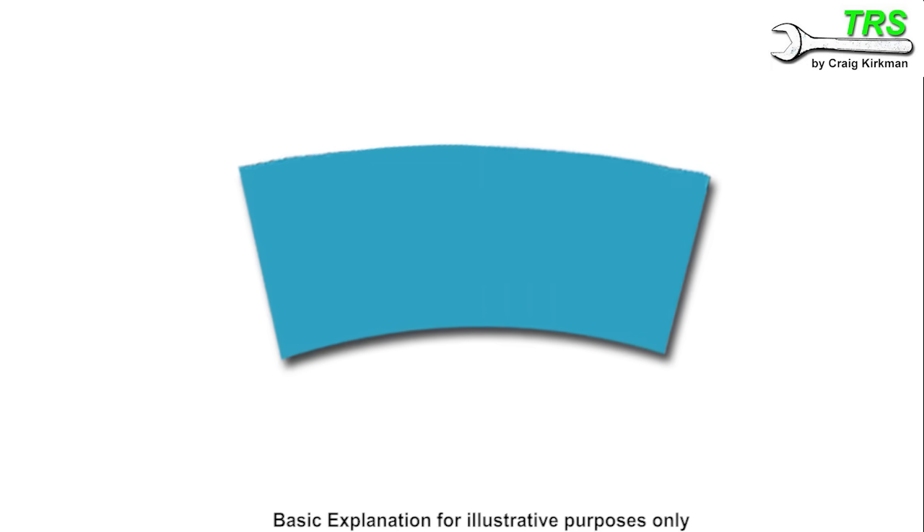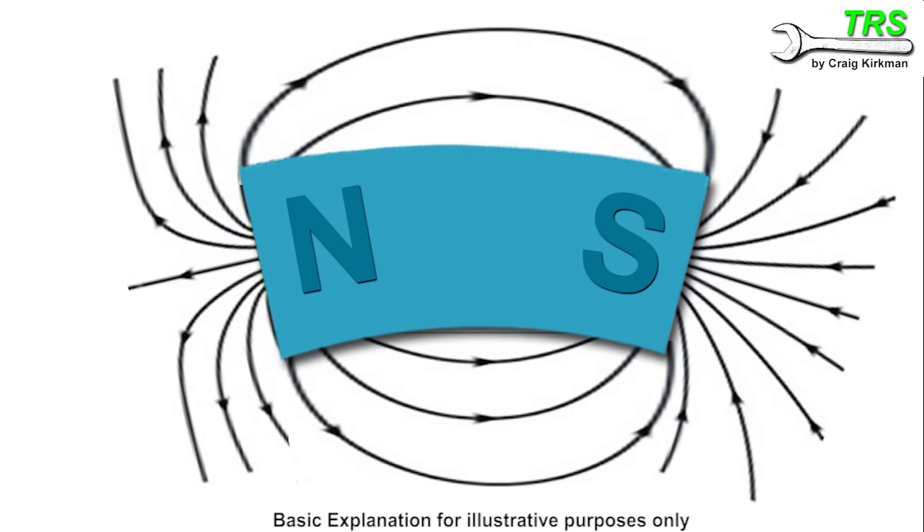It's this whole system that's designed to work with the fixed magnet on the flywheel. Like any fixed magnet, the fixed magnet on the flywheel has a north and a south pole, and its magnetic field is orientated with the flow running through the centre and out. This magnetic field on the fixed magnet is constant — it's always there, it always exists, meaning it's never turned on or off. And that's exactly what's needed to fulfil its job.